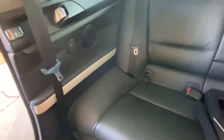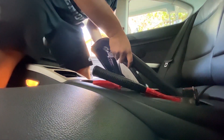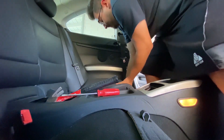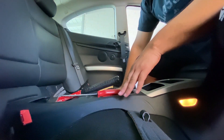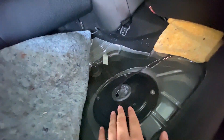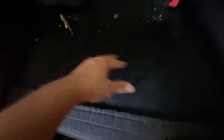It's a really small space because I have the coupe, but I'm going to start by taking out the seat — there are some clips holding it in, but I think you just pull up. There's the carpet, and I'm pretty sure it's underneath. I'm pretty sure this is the fuel sending unit right here — looks like maybe an 8mm bolt.